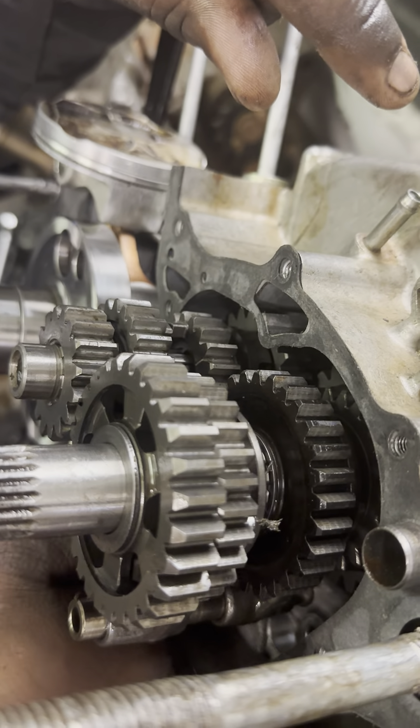Now I'm going to shift it again — and that's fourth. I can show you which gear just engaged: this gear right behind second gear, which is here and here, just engaged. I'm going to wiggle it a little bit so you can see it move. You see that? It moved up so it can engage with the gear right behind second gear.